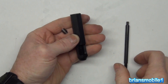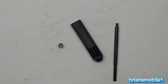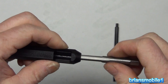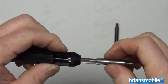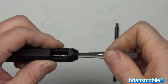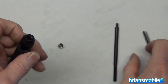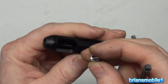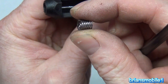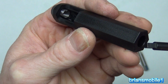The time has come to load this. Right out of the gate, since these are plastic, sometimes they're not cast exactly perfect — so I'll just chase the threads with one of these, and this will save you a ton of grief. If you run it through with your tap, you'll find that it works way, way better. It's kind of stretchy — it's got a little bit of give to it and you get a lot of drag. So at the last, just be real careful. Clean it up, make it a good tool. You put the tang with the little brake mark at the bottom of the coil in there — doesn't matter the orientation, just so long as that tang's down at the bottom. Double check it, make sure you're looking good.